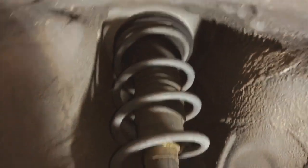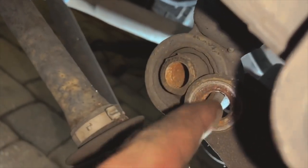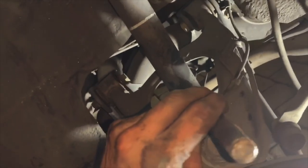Alright. Took off the back. These things are stupid long. So, all you have to do is take this long bolt out. Where is it? About the same size. So that just goes through, and then I just took a chisel, and since I'm not using these coilovers, I just hit the bottom of the coilover out of its little placeholder or whatever, because there was some tension.